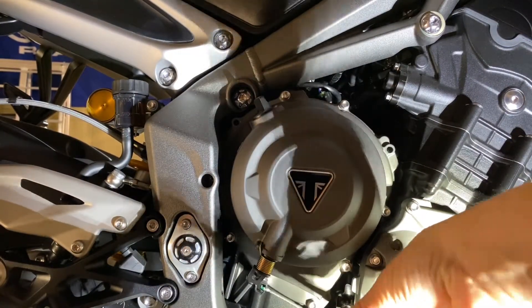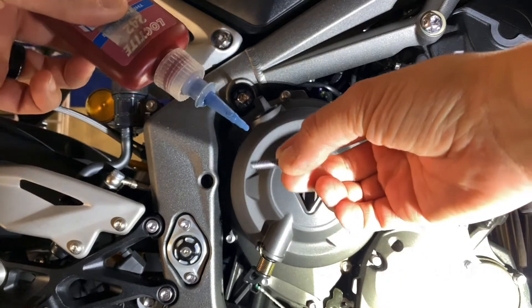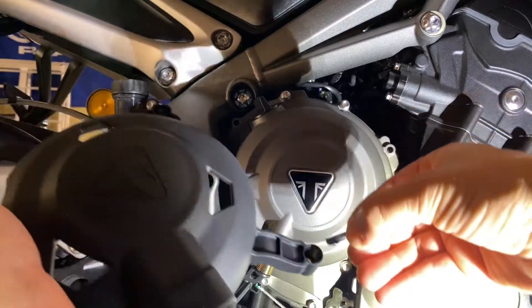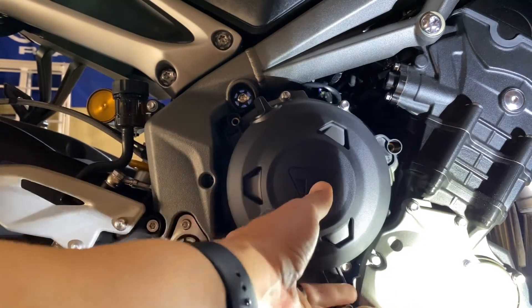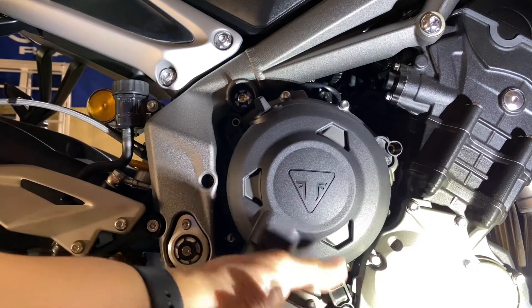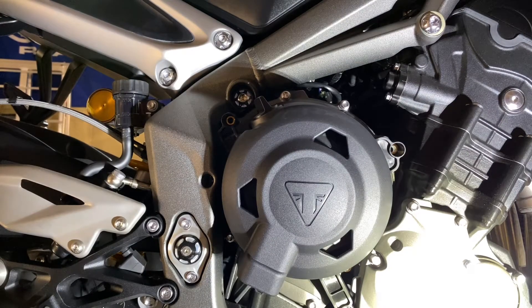This one has a clutch cable holder, so it comes down and you just put it back to it. Just grab some of your Loctite, put it on so it doesn't come out. Put it through and grab the Allen wrench. Start it — I wouldn't tighten it all the way until you actually have all three in.